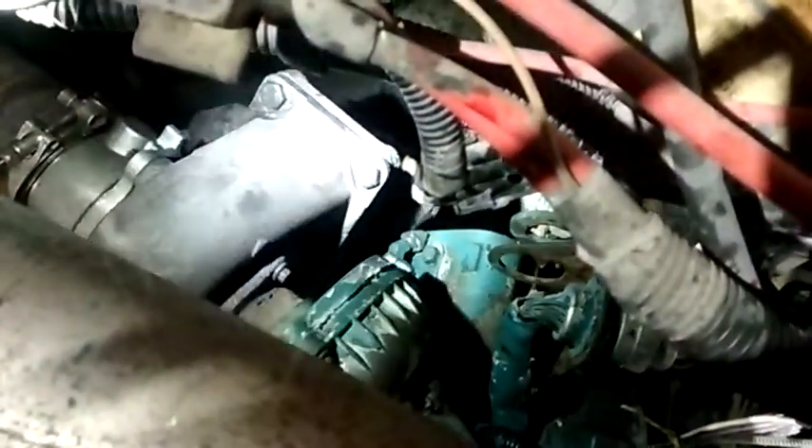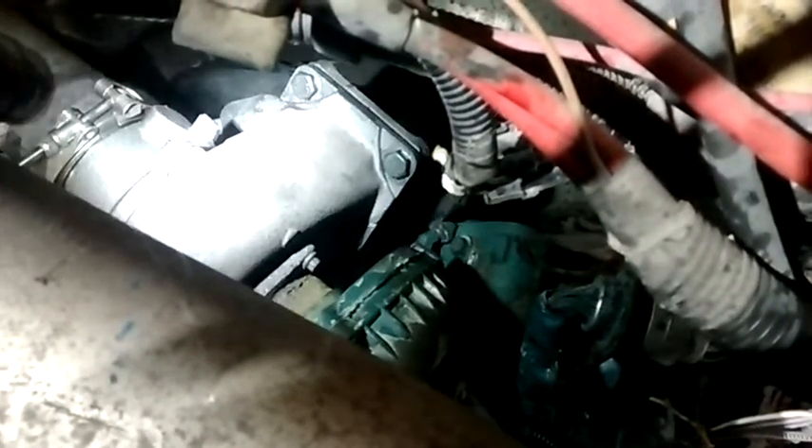If you did want to attempt this job, here's a quick breakdown on what was involved. This large tube right here had to come off — there was a hose clamp there and another hose clamp right there at the turbo. There's also this saddle clamp right here that you've got to pop open. And then back on the exhaust, you see that clamp right there — that's got to come off. Then the turbo has two bolts and two nuts — four bolts total — and I had to use a torch and heat those up to remove them. After those bolts are off and you get the hoses out of your way, there's a Y pipe down here that's got to come off.